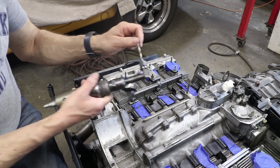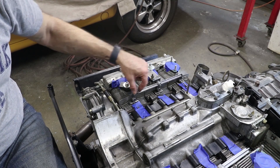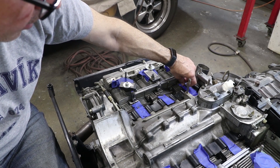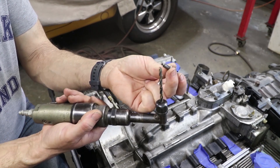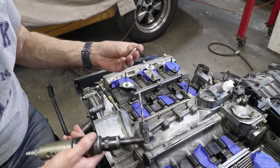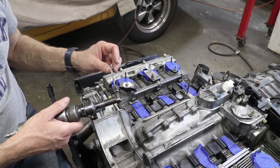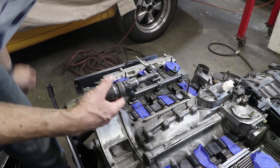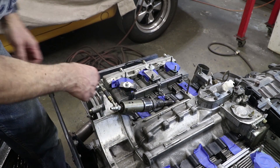Now it's time to go the final step. This is the 5mm drill required for a 6mm tapped hole. I've reinstalled the bridge, which is also the alignment tool, and used the previous drill bit to make sure we're locked into those original holes — all three fit right in the hole. The second hole is going to go much easier because the first hole is already there. I have to use a new drill bushing this time — an aluminum bushing. It does spin a little bit inside the bridge, but this hole is going to go quick. This basically just controls the position of the drill bit.